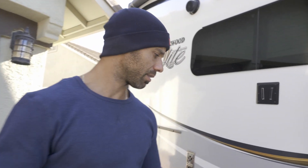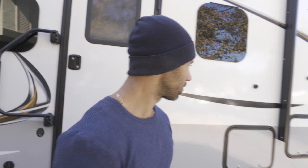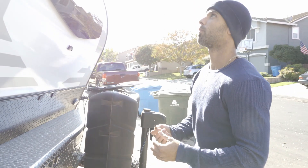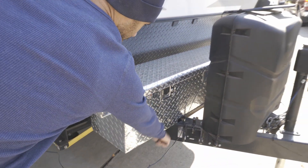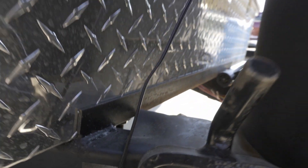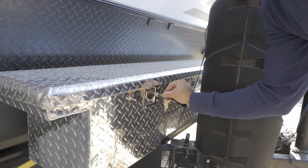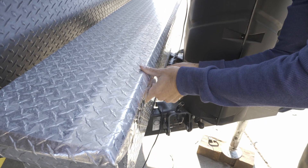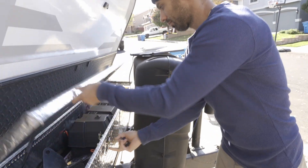I've got a hell of stuff to show — some of the upgrades I've done. This is a Crown Point custom style RV, a 2019 Forest River Rockwood Mini Light that me and my wife bought. I added storage up front — I welded a frame using one-and-a-quarter inch aluminum angle iron and built an aluminum box so it's lighter, and I re-keyed the lock to match all the other locks.